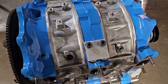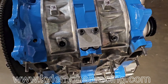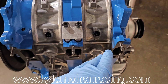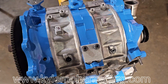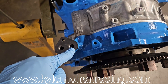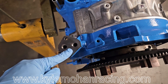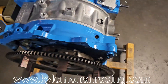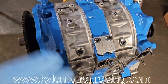So narrowing the rotors — side cutting for high RPM — and upping the oil pressure with a race regulator. We also did some porting to the front plate where the oil pump sits to ensure the best oil flow possible. And even on the back inlet for the main oil feed into the motor down the block, it's also been lightly ported and polished — just port matching, cleaning everything up to optimize oil flow and performance.